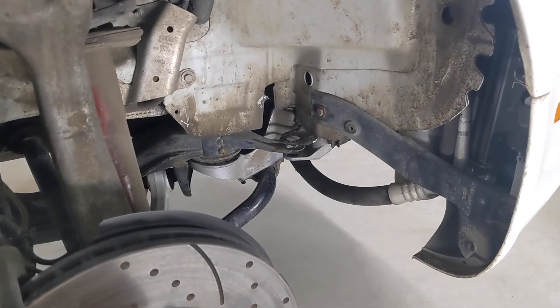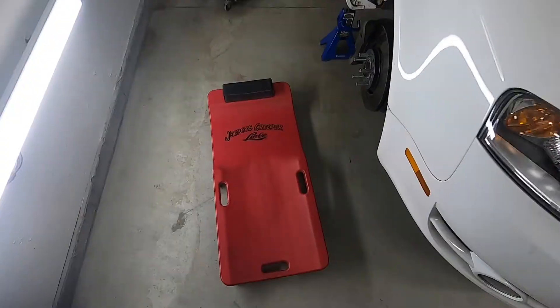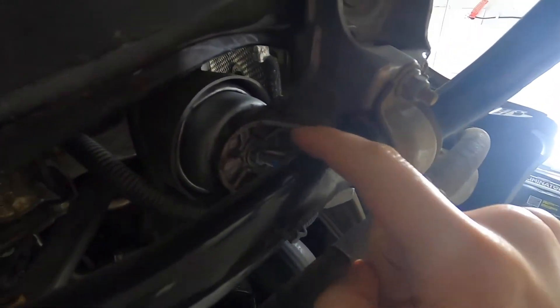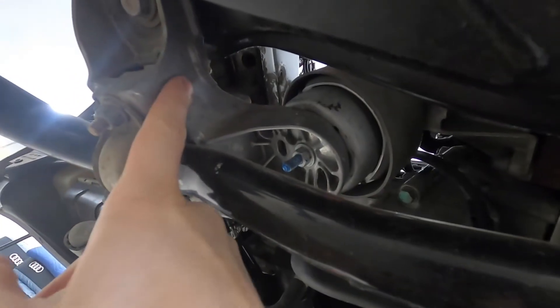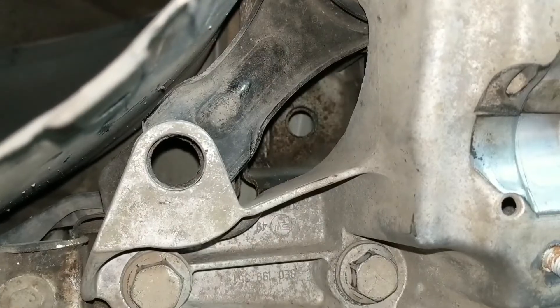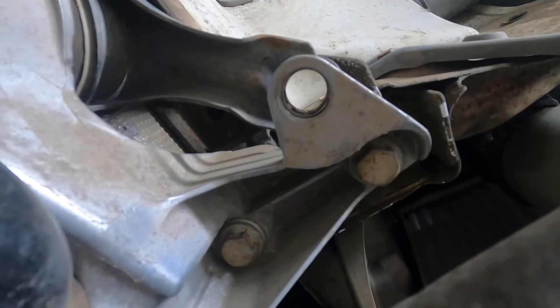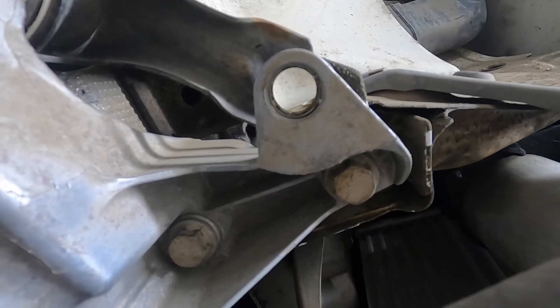So let's get back to the why — why do I even need this tool, what did I do before that I need to fix, and what does that have to do with wheel alignment? It all started with the work to replace my motor mounts. Here's the passenger side tucked up here, driver one right here. And to do that, you've got to drop three big bolts to get this bracket disconnected from the subframe. When I was doing the job, I was smart enough to notice the alignment holes, but I wasn't really smart enough to do anything about it at the time other than eyeball it and try my best. And honestly, looking at it, I think it's actually pretty good — but we'll test it soon.